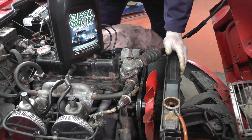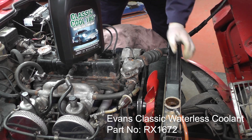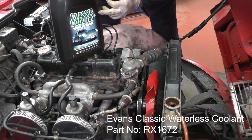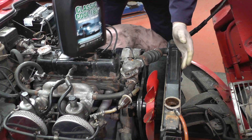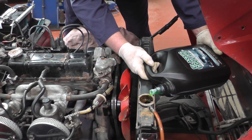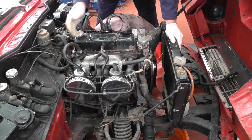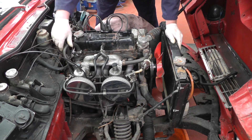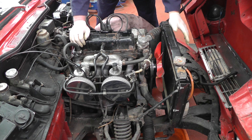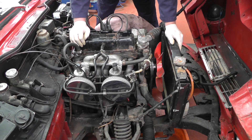We've flushed through the radiator and cooling system and totally drained it of any water. Now we can add this special waterless coolant, which will save any problems further on. Fit the radiator cap and then start the engine, warm it all up, feel that the hoses are getting nice and warm, and make sure there are no air locks in the system. You may need to top up the radiator as well, and when it's fully topped up it should be okay for the following day.